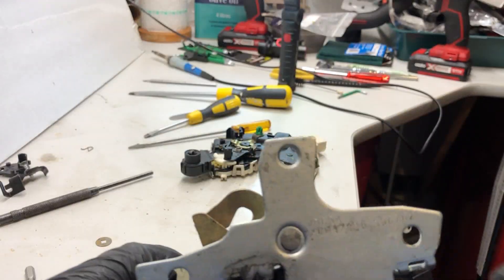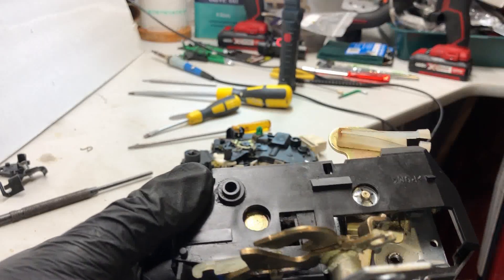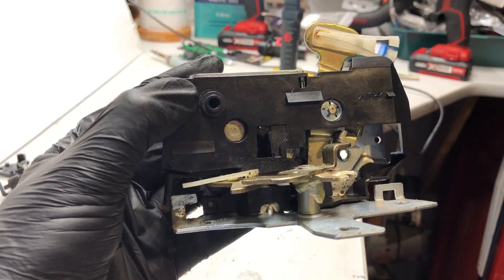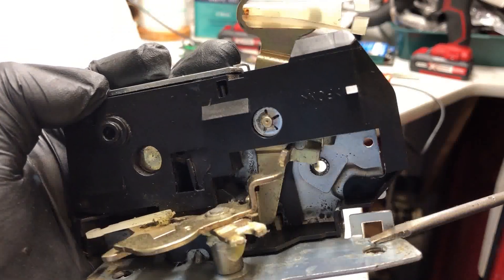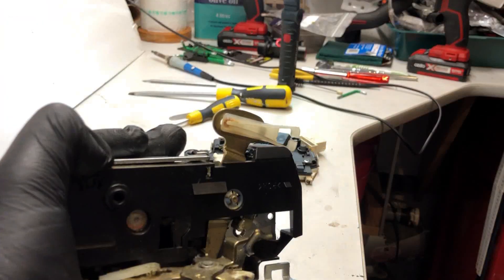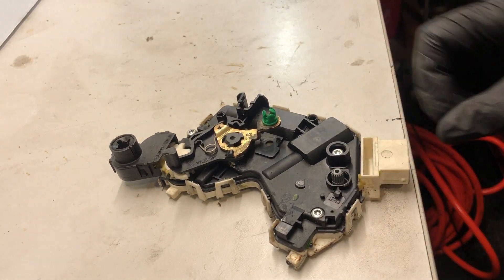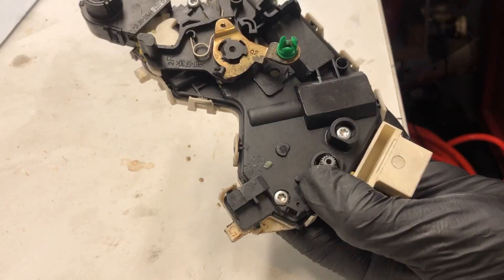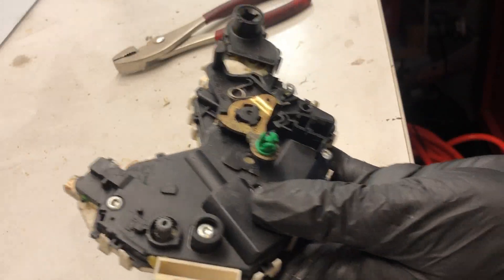Those clips are coming through here — this is pressing down on the module you're trying to remove. This side was easier to get out than the passenger side. The trick seemed to be to get a screwdriver in here and wedge that way, and here and press it that way. Now if you're like me, you'll probably convince yourself you can get these clips off gently — tried and failed on the passenger side. This is because you've got one, two, three, four screws holding this together. So I'll just take these Torx screws out.